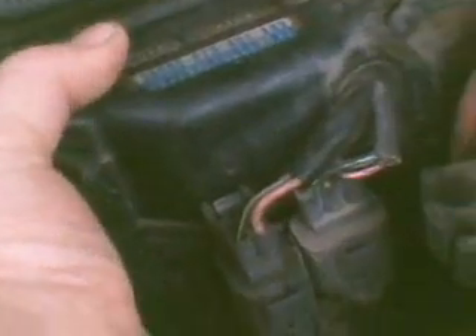You've got a bolt there and one on the other side — those would be 10 millimeter. Disconnect those and this comes out. You don't have to take them clear off because you're slotted there. I also disconnected this hose from the fuel canister down at the bottom, and there's a hose connection right there. If you could disconnect that too, that would help you a lot.